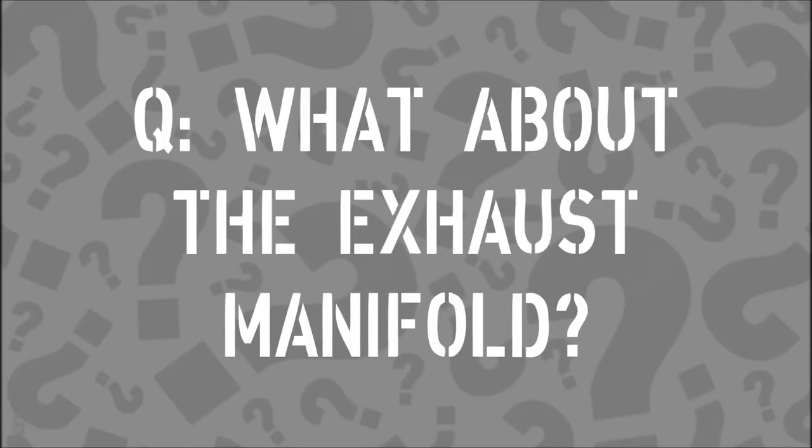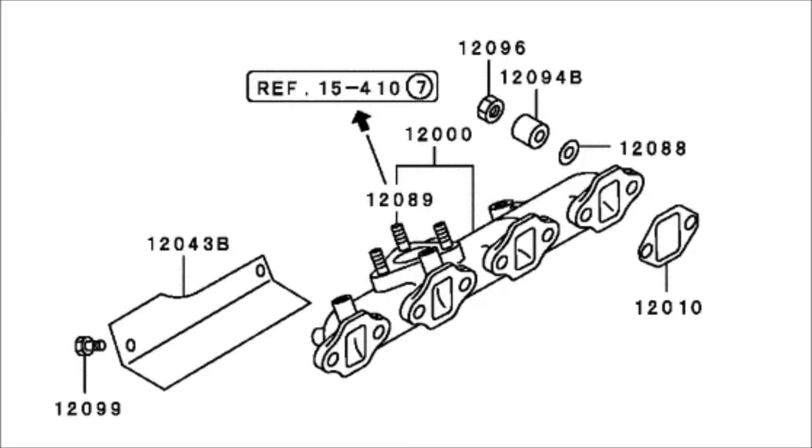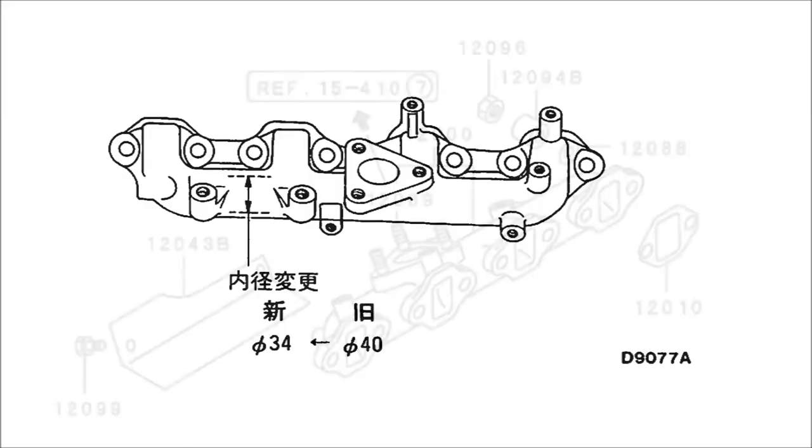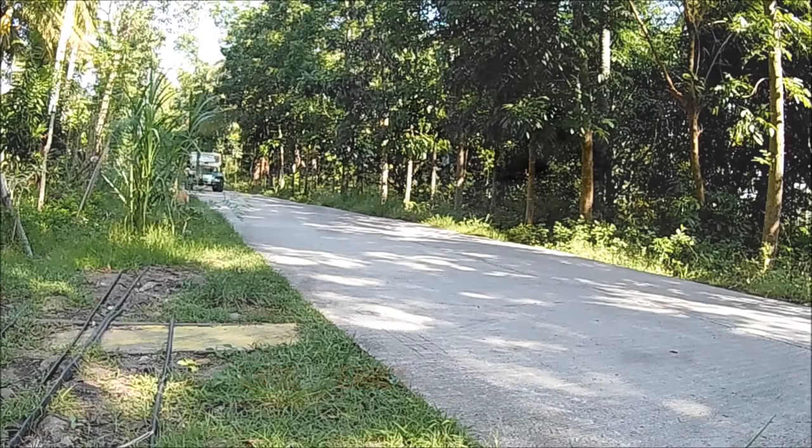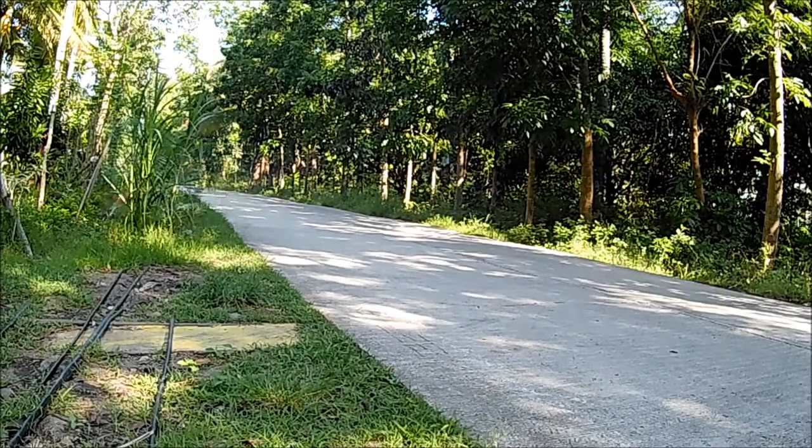What about an exhaust manifold? The 4DR5 turbo and 4DR6 have identical manifold gaskets and the manifolds look to be identical — I think they would both bolt right up to the NA head. I think the only difference between the turbo and NA heads are the EGR system ports. Pay attention: the early 4DR6 manifold has 40mm runners (internal diameter), and the later ones only have 34mm runners. So if you're looking for power, get the earlier 4DR6 manifold. You will not notice any turbo lag even with the bigger manifold. I've put the power numbers for both in the description.